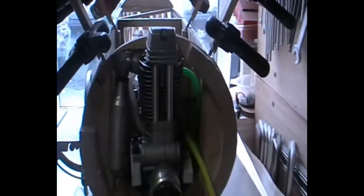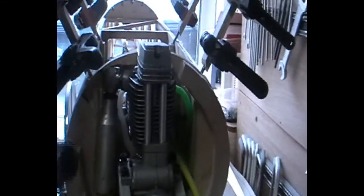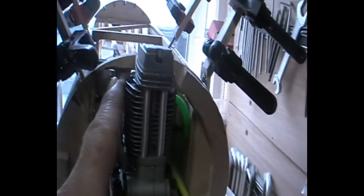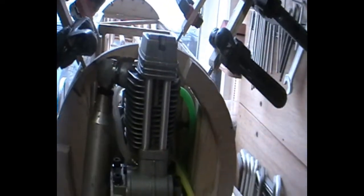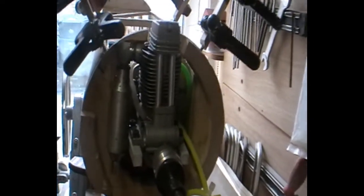Okay, quite pleased with this because the whole wings, I've done all 4 wings. See, all done. Okay, and now the other thing is, going to that show yesterday, I found the Just Engines store, which I was quite pleased about. And this, the knuckle I was on about, there's the original that came with the engine. And then Just Engines give you a 90 degree knuckle that screws straight into the cylinder head, and obviously the other side for the silencer. Nice and neat, so you can see it all fits inside, so there's nothing protruding out of the cowl that way. I was bad enough having the thing out, but that's the way it goes.